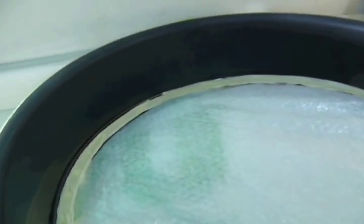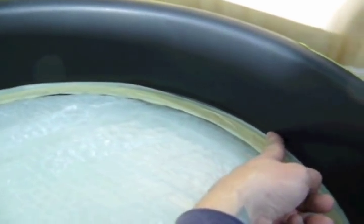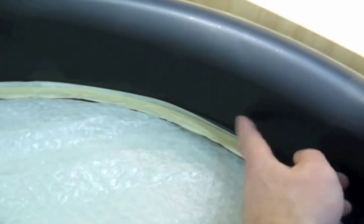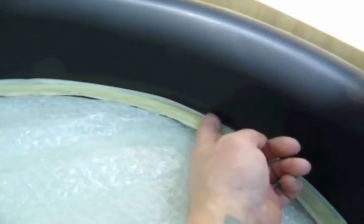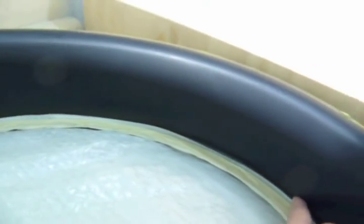I'm done wet sanding, and as you can see, I peeled off the tape that was riding along the wall. So now my buffer can get in there and buff that area that'll go from orange peel to no peel. And I won't have a problem with trying to dig my buffer in the corner getting out scratches, because there is no scratches down there.